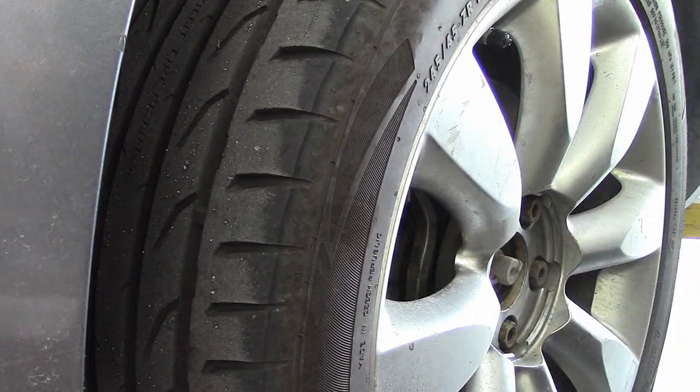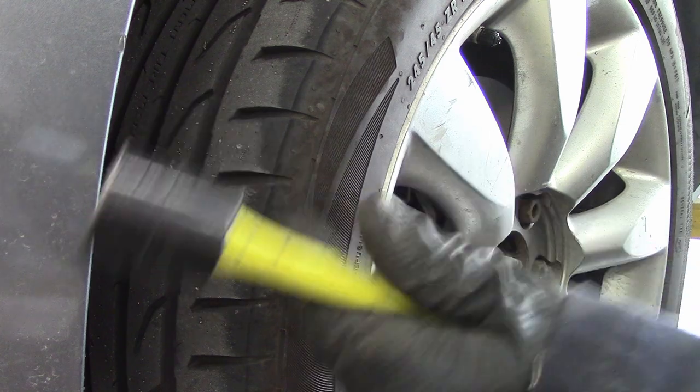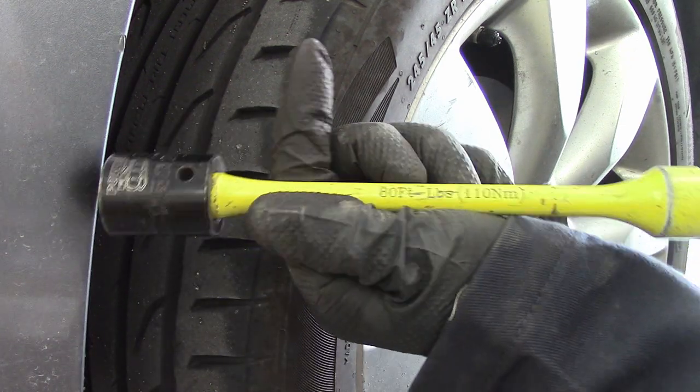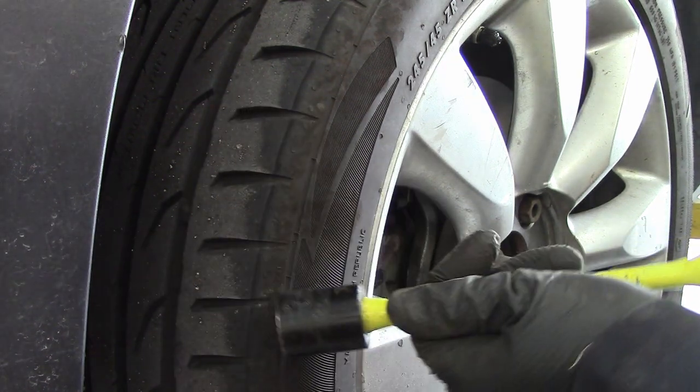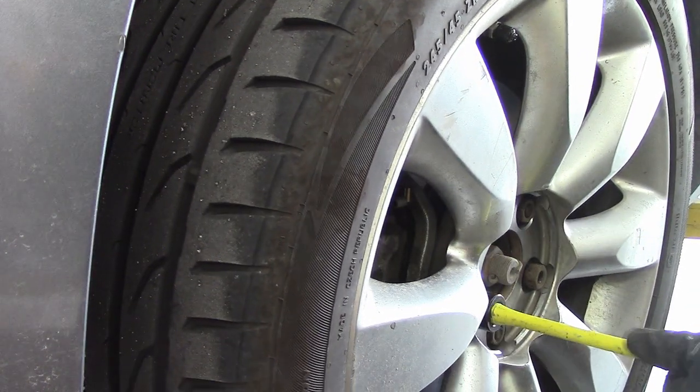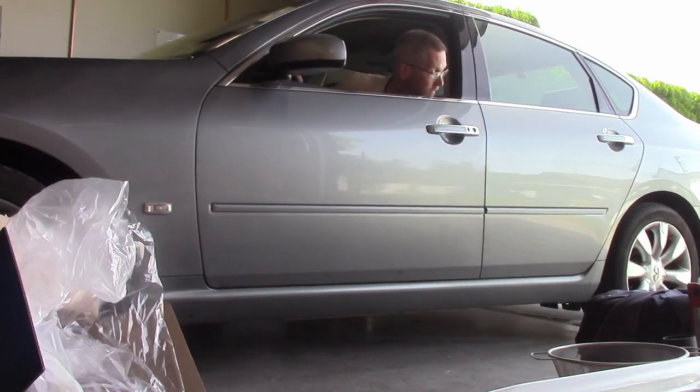Golly, I love the smell of brake clean — love me my solvents. In this case I'm using my impact torque bar. It's rated at 80 foot-pounds, usually comes out closer to 75. You put that on your impact and you rattle it home with fury.